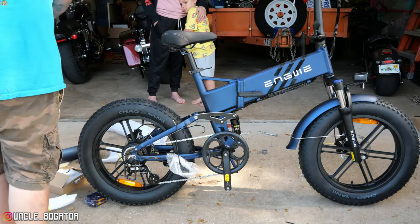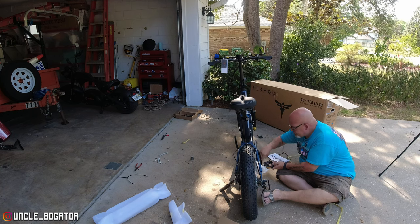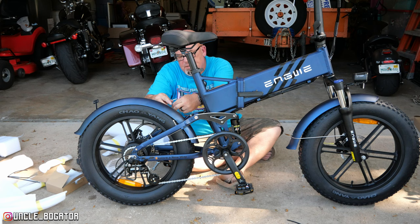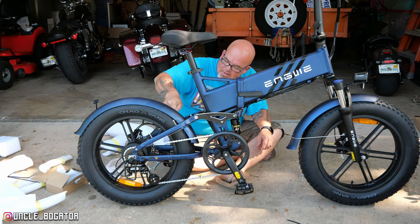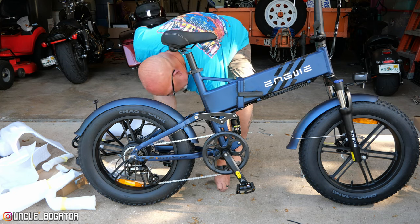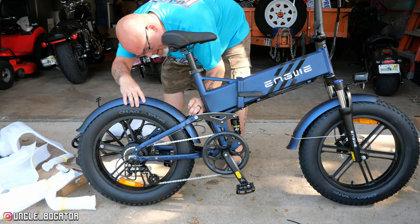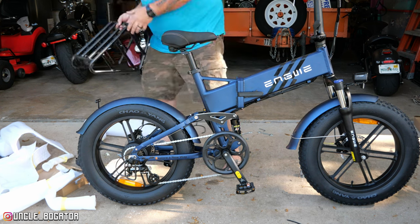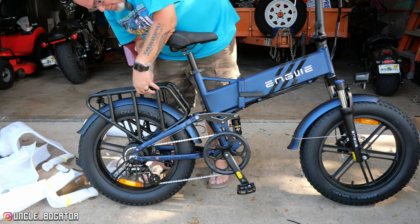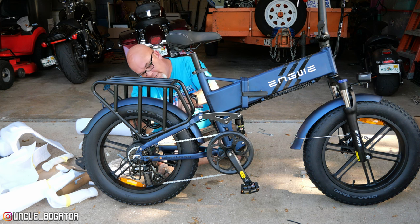This thing wants me to put pedals on next, then we'll have the fender and the luggage rack. The left side is going to have an opposite thread pattern. You've got some screws going all around this swing arm — we're going to take these out because we're going to use them to mount the fender and the luggage rack all in one. There's one tab in the front, and at first I'm thinking there's no way this is the only thing holding those on — but the way this thing mounts, they all butt up and support each other, supported by the swing arm. So we put these in mostly tight, make some fine-tuning adjustments, and then tighten up from there.